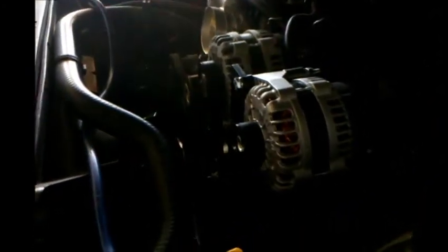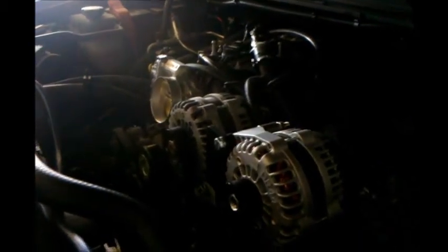Got a mock-up here. I got the second one in, got the belt on to make sure it fits. It's got the belt tensioner almost tightened all the way down so it's a real snug fit. But dumbass me forgot the support bracket that goes in the back, connecting the top bolt to the bottom bolt of the OEM alt.